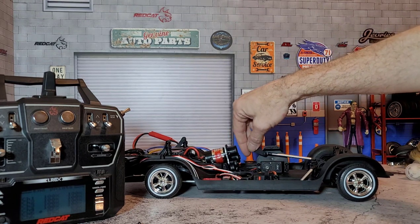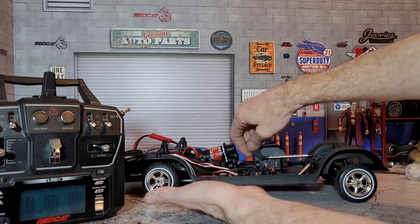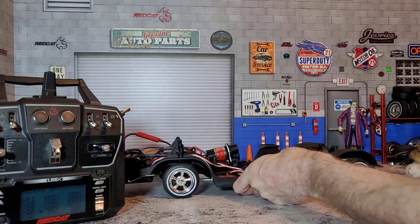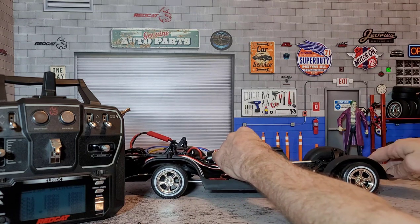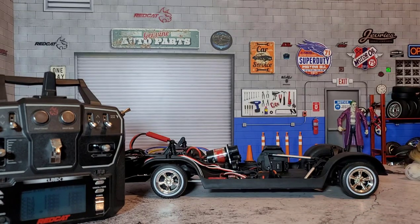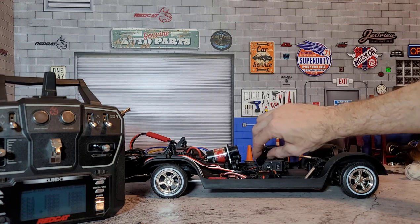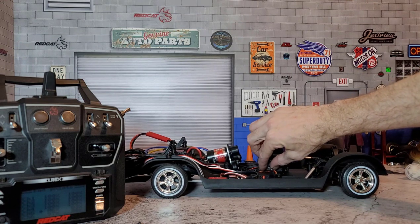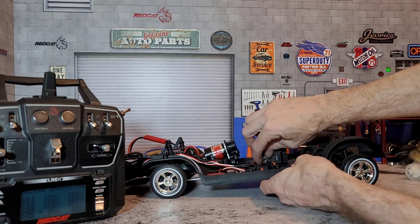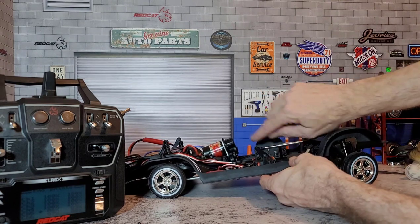You got to look at that very, very closely to make sure that there's no flex or pressure on it trying to push the front further than it's supposed to go. And now you might think, well, if I just have it all the way to the ground, when I put the servo horn on, everything's going to be perfect. No. And the reason is, the endpoint steps go, let's say, 3 millimeters in each direction. So one step on the endpoint will be like 3 millimeters of movement on the servo horn tip.